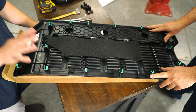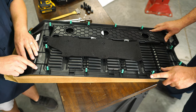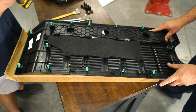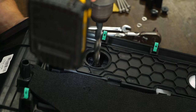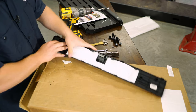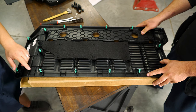On the back side of your tailgate panel you're going to locate four locations to drill out using a half-inch drill bit. There's a location right here and right up here — those are both the top locations. If you flip it over, down towards the bottom there's a small dimple on either side, and those are going to be drilled out to a half inch as well as the inside of these two protrusions here. Go ahead and grab yourself a drill with a half-inch bit and drill these out. If you're watching this, you can just pop off this panel — we gave it a little force and it popped off — so we'll drill these out with it laid out for a bit more maneuverability.